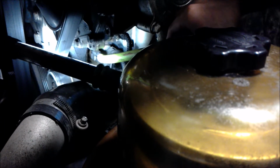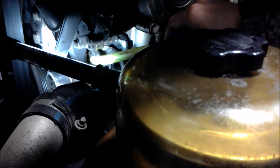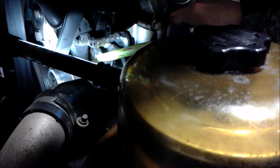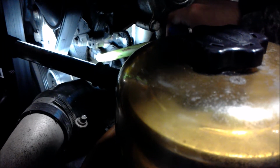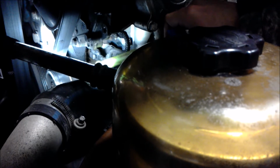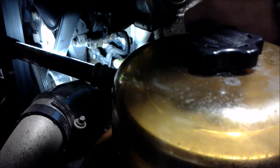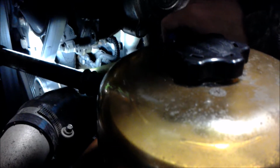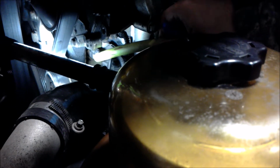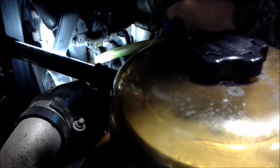So back here we'll have our oil temperature. It's a 2-wire sensor. Most 2-wire sensors are considered just automatic feedback. That's what most temperatures are. When they have a signal wire, most of the time they're a pressure sensor, which would be the one right next to it. So we're going to use our oil temperature to tell us how hot the oil is and report it to the ECM.